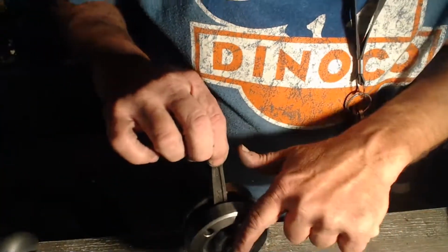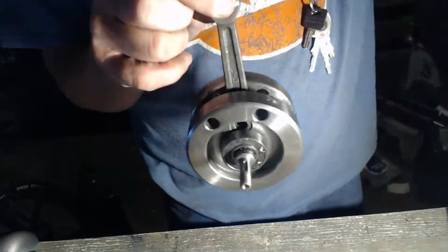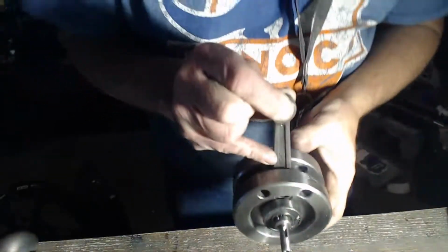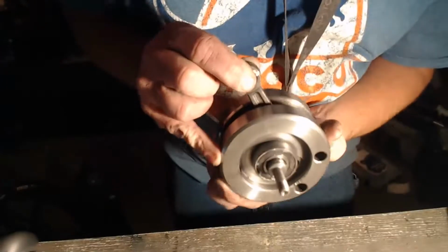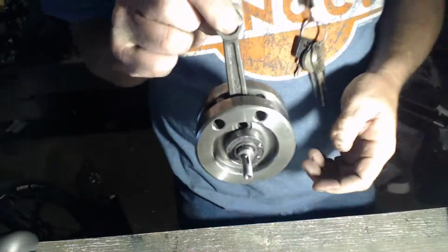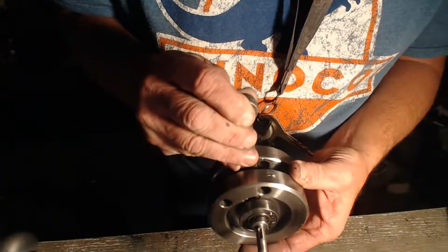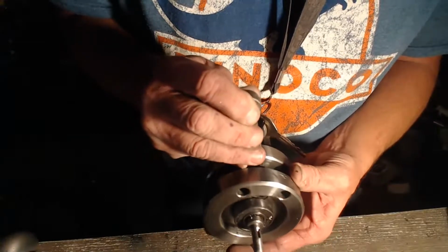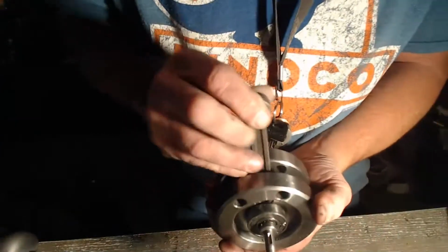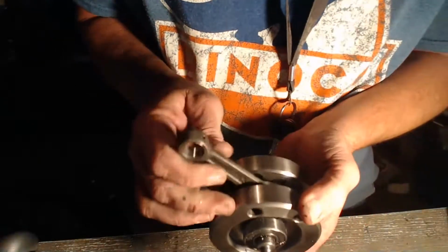But if you made a clock arm, like on a clock, and used it and set it exactly the same as the Woodruff key, it could work as a timing gear or a timing wheel. And instead of the timing wheel moving, just the clock pendulum moves. And knowing that at 1 o'clock, what that means is this is going to fire at noon, at 12. And when it hits 1, the combustion should be enough to start pushing down. Okay, if we advance the timing, meaning a little earlier, we're going to shoot at 11:45. And then retard the timing, or the other way.